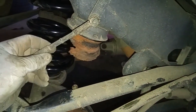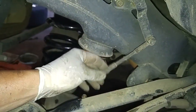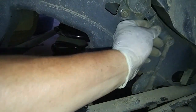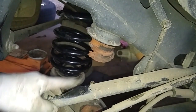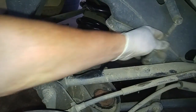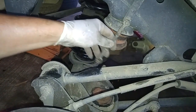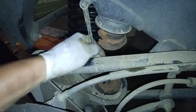This is a level sensor. Based upon where this lever is, it'll send a signal back to the air compressor to add either more or reduce air. For the rear end, it's used primarily for towing situations, but since we're just replacing it with standard metal springs, this is a rather useless component of the car now. This doesn't mean anything, but just reconnect this thing. That takes care of this side.